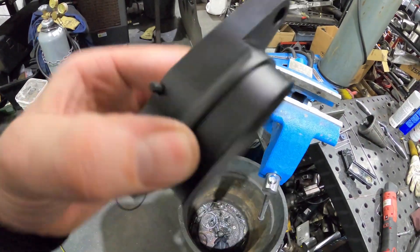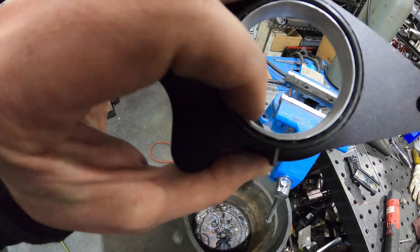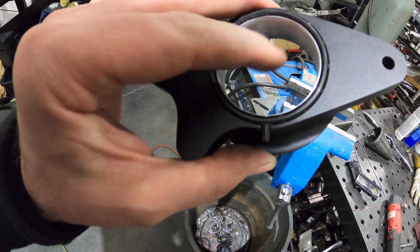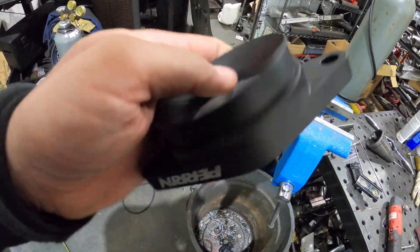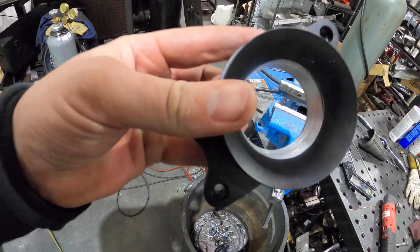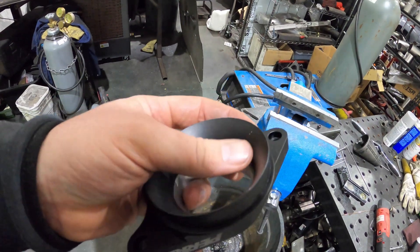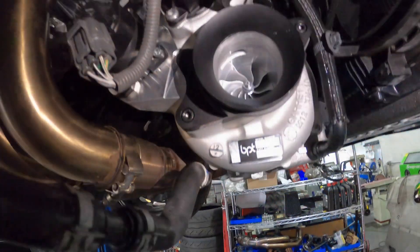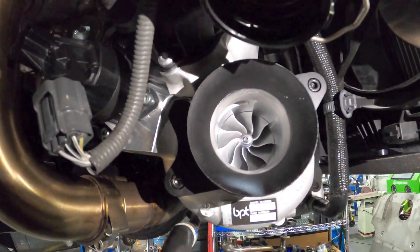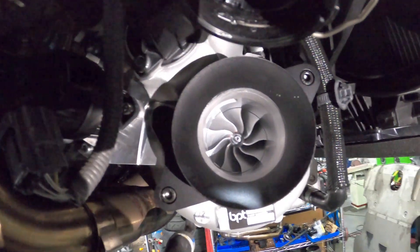It's not perfect, but it's better — it's pretty much a knife edge on this side now, as much as we can get without compromising the o-ring. Since it's a mass airflow meter car it has to seal with that o-ring, so it's as good as we can do. It should hopefully help just a hair and make a couple more horsepower, or at least not prevent it from making more power down the road. Still just a tiny bit of a step there, but not bad.